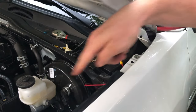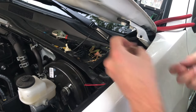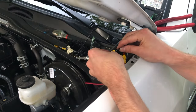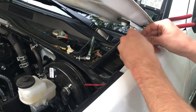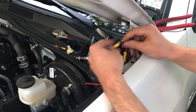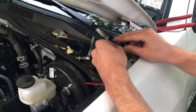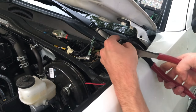Even though I just wired the ground to the new fuse box, you don't necessarily need to use that. I'm going to go ahead and just ground right here — it works perfectly. I just took the screw out right there and it's going to work flawlessly, so there's no reason to waste expensive copper wire if it just works perfectly right here. I'll go ahead and crimp.